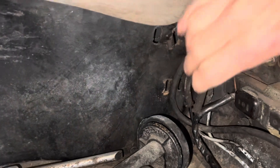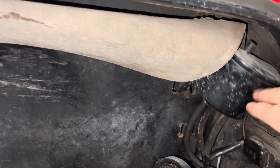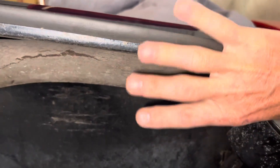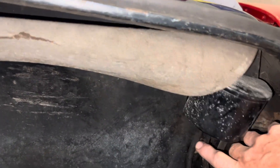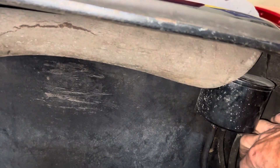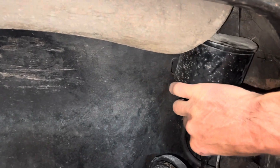What's happening is all those fumes are venting straight into the car. This tank should be connected to this cardboard piece here with the clip — the clip is still there but the tank is just flapping about loose. There should be another clip here for the three pipes, but in the first instance what we need to do is reconnect this, and that should solve our immediate problem.